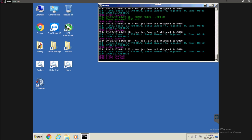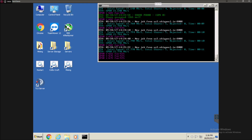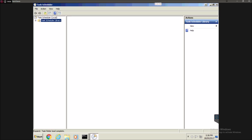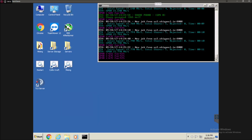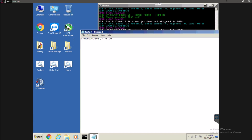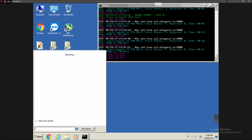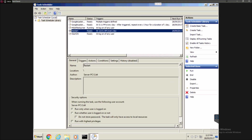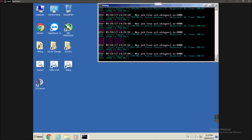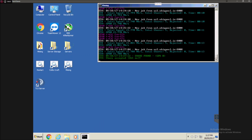This is mining 24/7. Something you may want to do to give the computer a break is I've set it to automatically restart at 12am every night. That just gives Windows a chance to reset and reboot, and briefly gives the computer a little bit of a break for a couple of minutes while it's restarting. To do that you basically just go into task scheduler and create a batch file, and that will restart the computer. Under task scheduler you can set it so that it runs that batch file at midnight every day. Then once you've done that you can also copy the mining batch file into your startup folder, so that as soon as the computer starts up it will start mining.